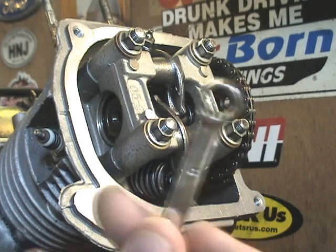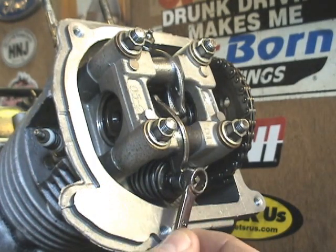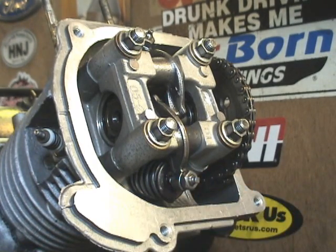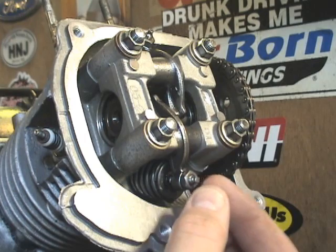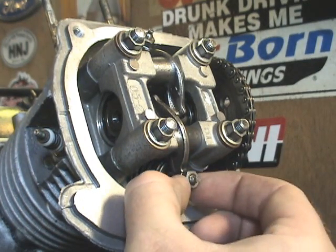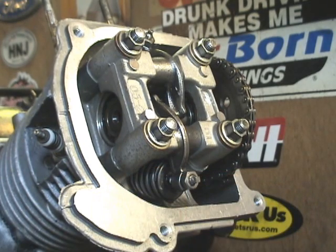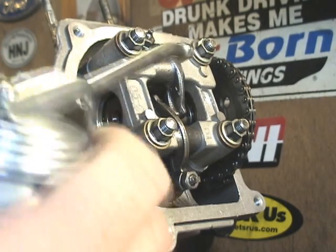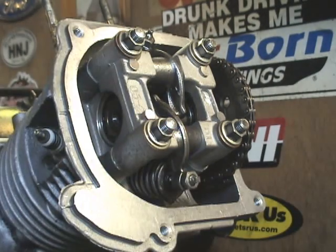What I want to do is use a 9mm wrench and loosen this nut right here. Once that's loose, you can turn this bit and it should turn away and create more clearance. I like to use a little bit of oil from a squirter just to make sure it's nice and smooth and I'm getting the proper adjustment.